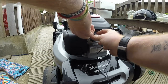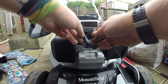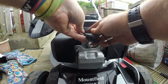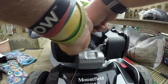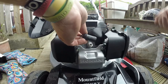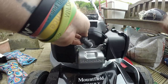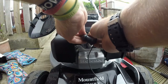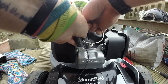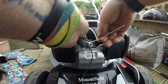You can do it with the casings on, but as you can see you couldn't see what I was doing, so I stopped the video and quickly removed the cover. The instructions say to wrap it 3-4 times; I always go 6-7 times, filling the HT lead of the spark plug up as much as possible within reason so you can still remove it for maintenance. You just coil it around simply — it comes with cable ties, but I use a larger cable tie as I find it holds to the unit much better. Pull the cable tie tight and you're 90% done.